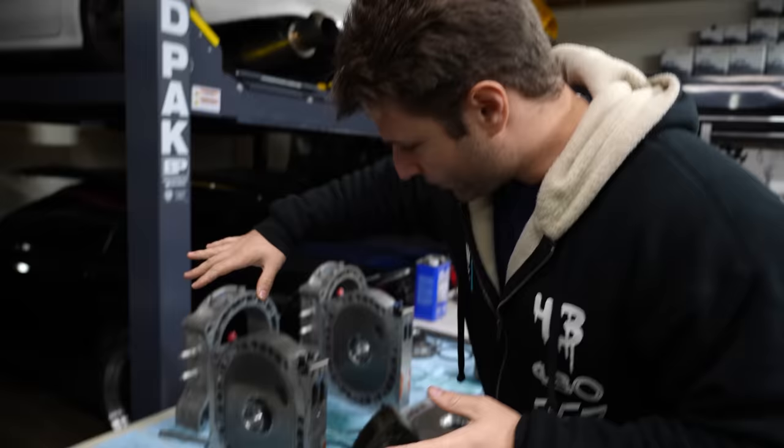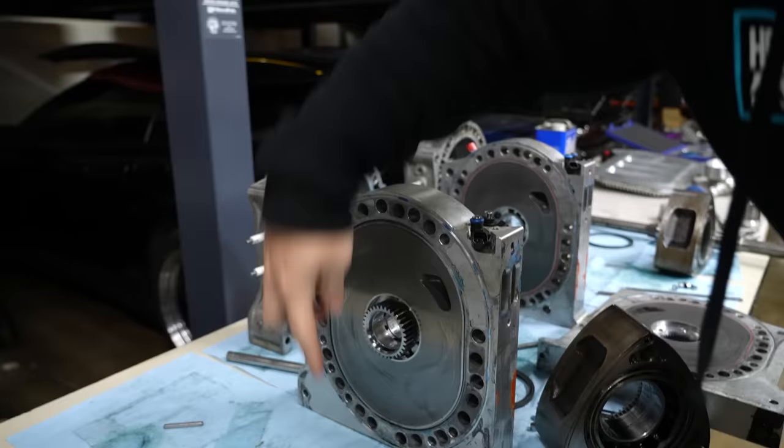And then you get diminishing returns as you go further. There are some people that run a lot more, but that is not absolute insane vacuum. That's just basically a slight amount of vacuum. Your car sometimes idles way lower than that. The oil system all drains down to the pan. The pan is at negative, let's say, 10 PSI, for example.